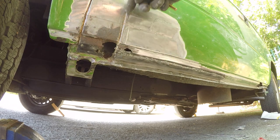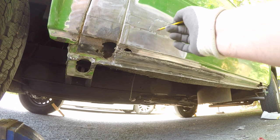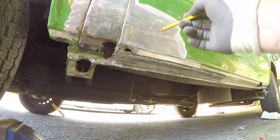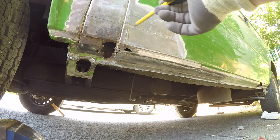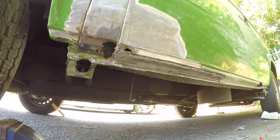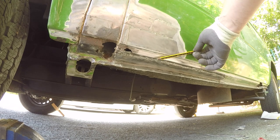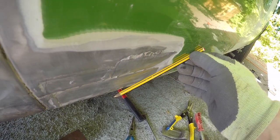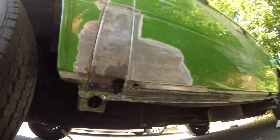There should be a nice sweeping curve coming down here. Luckily the edge here still hasn't been welded. There's actually three panels that have been let in here — one there, one along here. They've welded along the end of the joint, which is a bit of a no-no in my book. Why they've let three in like that, it's just ridiculous. They've cut across here. You can see the original panel in this part here and here, so they've maintained the lines. But the amount of filler is just absolutely ridiculous. If I put the pencil here you can see there's a good eighth or so of filler. Looking at how well this is going to come out — if I bring it up and around, you can see the amount of filler is absolutely ridiculous. Obviously there would be a radius there, but I'll start.